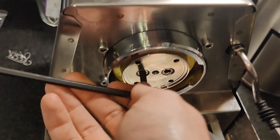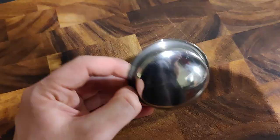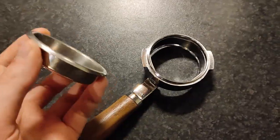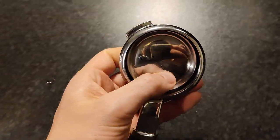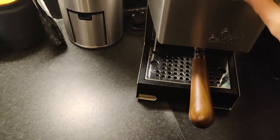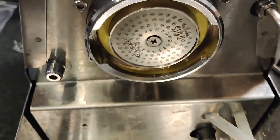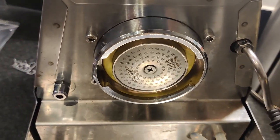I'm actually just nipping these up — nothing really tight, it just doesn't need to be. So this is a blanking plate. I think they come stock with the Gaggia — if they don't, they're really cheap to buy and quite useful. They're useful for cleaning and for this mod. What they do is go in the portafilter in place of the basket — it just clicks right in — and simply blocks off the water flow coming out of the group head. Using the blanking plate, I'm going to see how well it seals and if it can hold up to what the machine is putting out. Turn it on and just run it, see if it leaks. Should have gone up to pressure by now — doesn't seem to be leaking. There is still a step but it's small. IMS shower screen, stainless steel shower screen holder, and new gasket — and that finishes off the stage 2 mod.